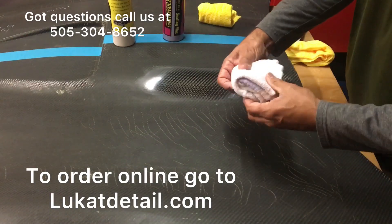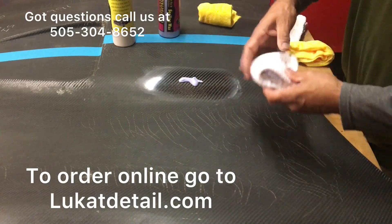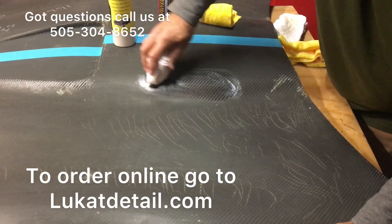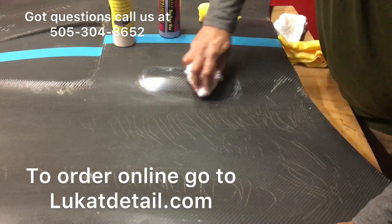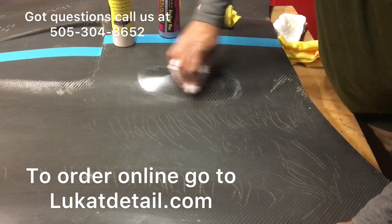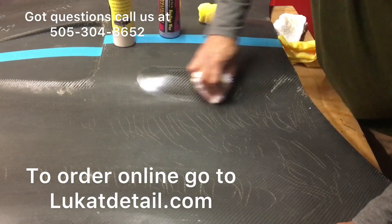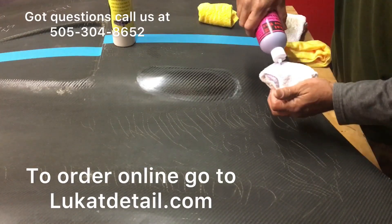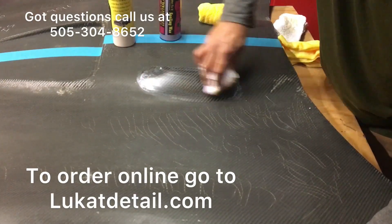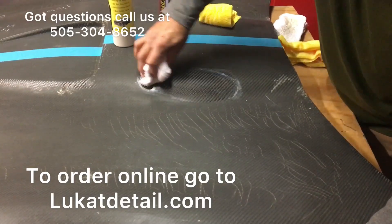I'm going to do the same thing — fold up the towel. You can put the product on the towel or directly on the surface, it doesn't matter, just keep it simple. This sealer wax is a combination carnauba and polymer copolymer — it's just a really awesome product. This does a lot. When I used to do detailing, this one did the lion's share of the work. Sometimes when you put it on paint jobs, it almost seems like the paint soaks it up. You want to let this cure for about 10 to 15 minutes. It's not a hybrid — it's a very simple formula, but it does wonders.